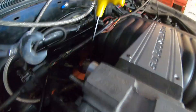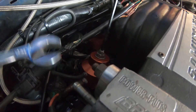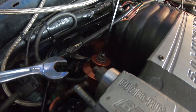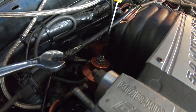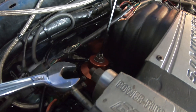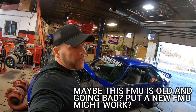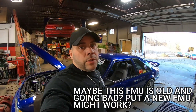So what we're going to do is, since I have an adjustable fuel pressure regulator, I'm going to go ahead and jack this up over 50 PSI. It's not really the optimal thing to do, but it was already at like 45-46. We're going to go over 50 and see if we can give it a little more fuel. It does look a little bit better than what it was, but it's still pretty lean. Towards the end of the run, as I took it to 6,000 RPM, it started getting down to 11.9, 11.7, which is where we want it — but it's untuned, so we're kind of in dangerous territory right now. I brought it up about six to eight pounds of PSI — it probably won't even matter, but let's see.